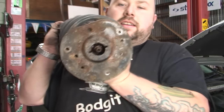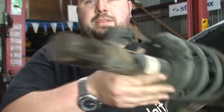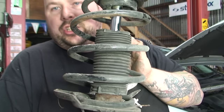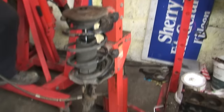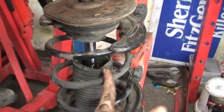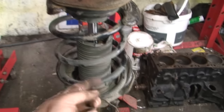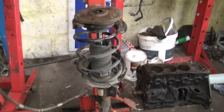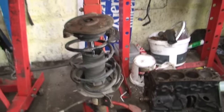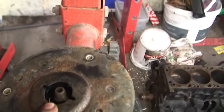We have the shock - in here is the shock top, the shock is here, this is what bolts onto the car. This is the whole unit. We now have to compress the spring, take the shock out. We have it in the air spring compressor. You can buy cheaper ones that just bolt onto the spring, but with any spring compressor be very careful because they are very dangerous. The ones you bolt on and screw up can fall and break, and the spring can come and hit you in the face. We're going to compress the spring now.